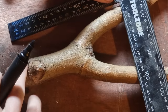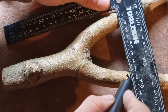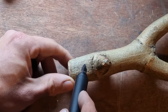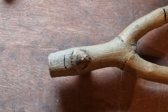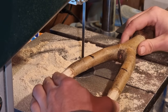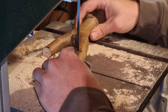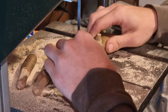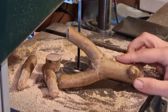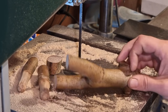We're going to mark it big and then sand it down. I'm going to mark it roughly at 100mm and we'll end up at 90mm. I'm going to cut it below this section, probably about there. Let's get this cut on the saw. You can take it away, but you can't put it back on — that's the number one rule when making catapults.